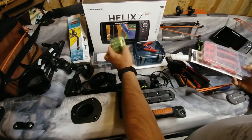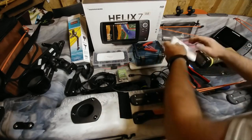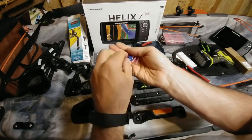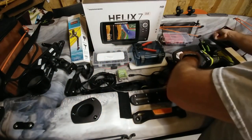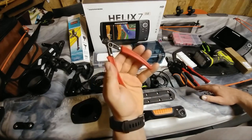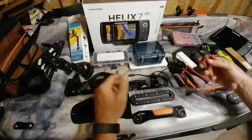We'll use the starport mount for the Rail Blaza, some heat shrink, and some cutting board pieces — I'll link the cutting boards I use down below. We'll have some electrical connections to do, so we'll need heat shrink butt connectors, spade connectors, and whatnot. Also, flush cut cutters — I highly recommend using flush cut cutters when trimming zip ties so they don't leave a sharp edge that'll cut your hand.